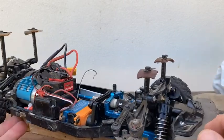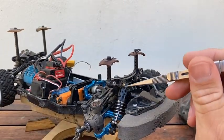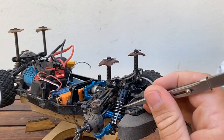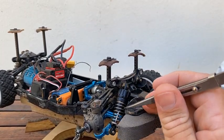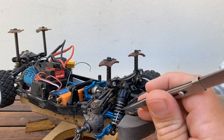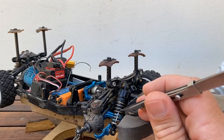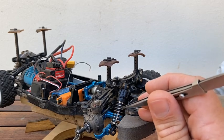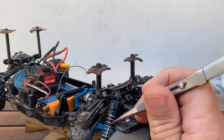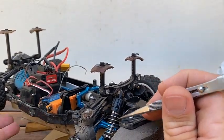After that, I got some oil-filled shocks to replace the friction shocks that came with the kit. I'm a rank amateur when it comes to RC cars, but even I could tell that these really made a difference. That's probably the first actual performance improvement that I made. So that's the front one. These are the Tamiya CVA mini shocks.